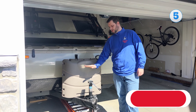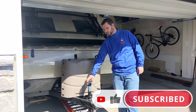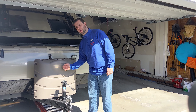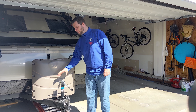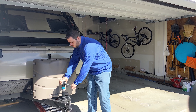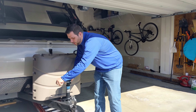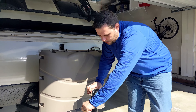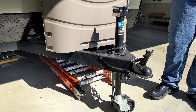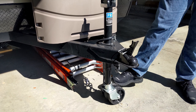This upgrade we did was to the front jack. We opted for another manual jack instead of hooking up an electric one. The previous jack would crank in a direction that constantly hit the propane tank, and it was also a lot thinner and not very sturdy. This new jack goes up and down in the other direction, so it's a lot easier and faster. It's also a lot thicker and sturdier but the fittings fit just the same. We also upgraded the wheel to a more robust one — this one has two tires instead of one.